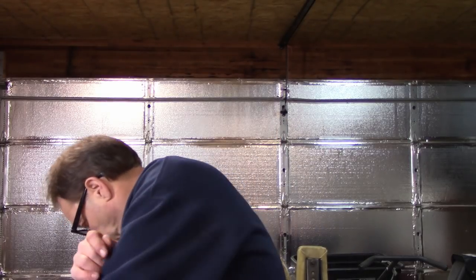So what's coming up next for this mower? I got to go through this thing all completely. It's my oldest mower. There's 1,400 hours on it. So I am going to have to adjust the brakes on this, because when you pull a brake or set the parking brakes and you're on a slope, it has a tendency of still creeping down. So I know the brakes are out of adjustment. So we're going to go through all that. The clutch needs to be adjusted.